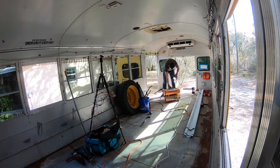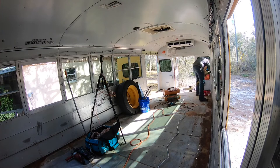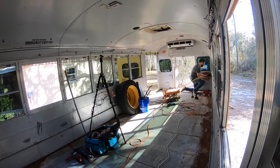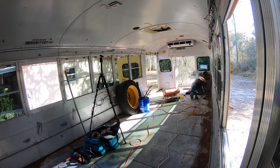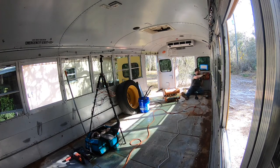I did try out a variety of different techniques and I've settled on a combination of some to get the job done. I was hoping that the air chisel and the air punch would work like I've seen online, but I think the air compressor I'm using is just too small to make the air chisel efficient. But the punch with the air hammer does work, so I have been using that to punch out all the rivets and then coming back with a chisel and a small mallet and just giving it five or six whacks and the heads of the rivets are popping off.